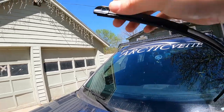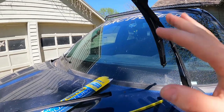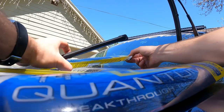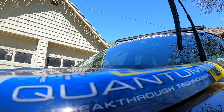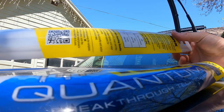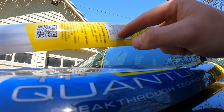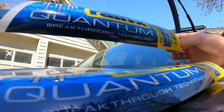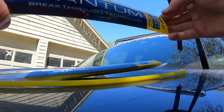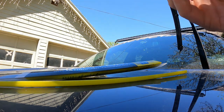That little tab too — that will tell me when it needs to be replaced. Before I go ahead and slap these puppies down, I'm gonna clean my windshield. Now I know for next time I've gotta make sure I buy the ones that have the pinch tab. That happened to be the QBW-F for the driver side, which is a 26-inch one, and then the QBW-D is a 22-inch one for the passenger side.